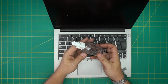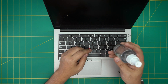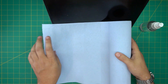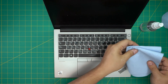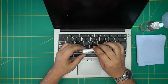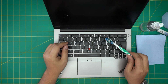I'm going to go over the tools we'll use first. Number one is alcohol — it must be 95% or 98% isopropyl alcohol; I'll leave a link in the video description. You will also need a workshop towel — one or two sheets. And you need a good thermal paste; Arctic MX-4 is really good to use on this brand.